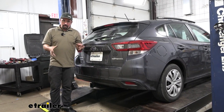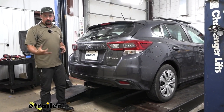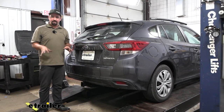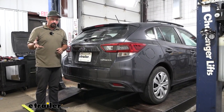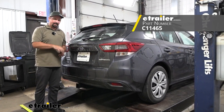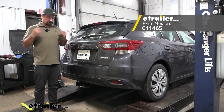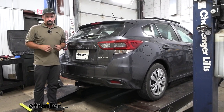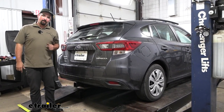When it comes to installation, this one does require the fascia to come off the vehicle. It's not really that hard to get off compared to some other vehicles. You do have to lower down the muffler, but overall this is a fairly easy installation. The other option available here at eTrailer is going to be the Curt, which is an inch and a quarter class one — so you lose capacity and you have an inch and a quarter receiver, which kind of limits you when it comes to picking up accessories. I think a little bit of extra work on the install is totally worth having the higher weight capacities and the two inch receiver tube opening.